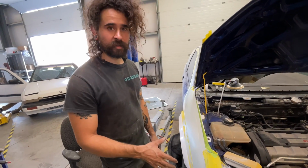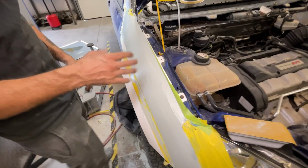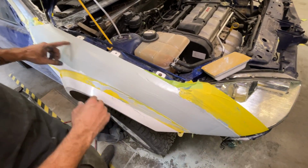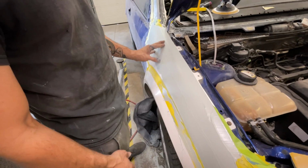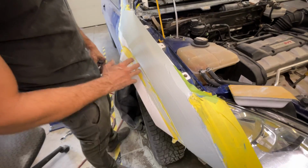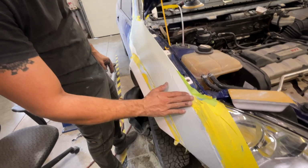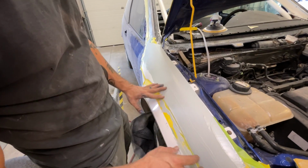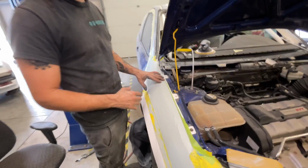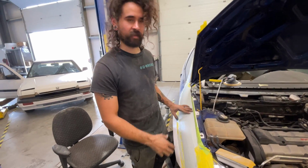Kitty hair all went really smooth. Just took one quick application, and then I went back over just a few little spots along this body line that had some dimples or some more weird spots. Got that all blocked out in 80 grit, and the last thing I did here is I just gave it a quick skim with some real nice creamy body filler just to fill in all the little pinholes and final gaps and everything, and I can sand this into a nice final shape for everything.